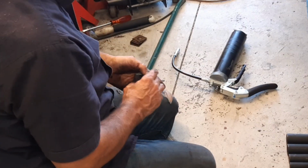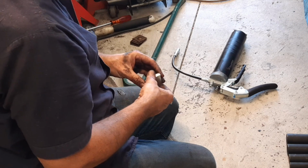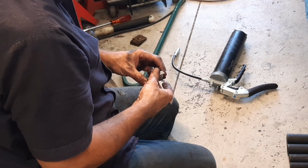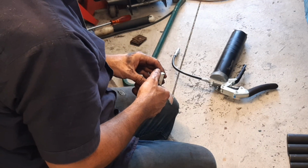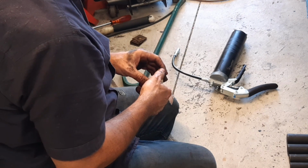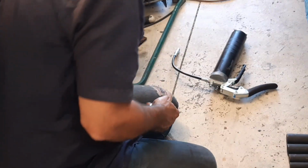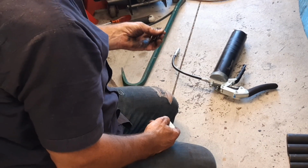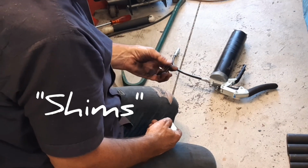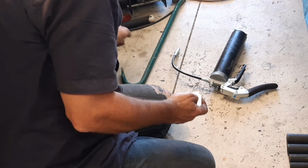Okay, so I've got all 4 body mounts, top mounts sitting in place, pushed up into the body locations, just hanging in place, ready for shimming and the bottom bush and then the bolts going through. So in pretty good shape here at the moment. I am now just going through and doing the shims. So I'm putting the same amount of shims that have come out. Here's the old shims, and I'm currently doing number 2 bushing. Number 1 and number 4 didn't have any shims in them at all. Only 2 and 3 both had 5 shims in them. So I'm putting that many back in again, and I'm putting the new ones in that came with the kit.